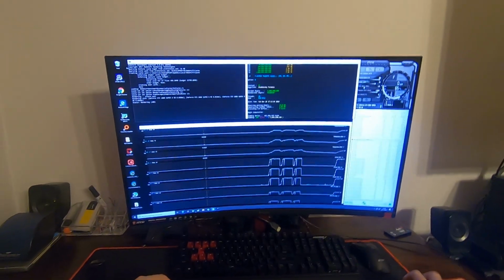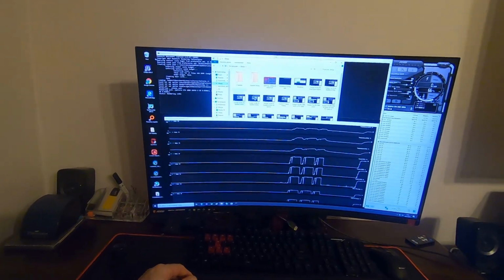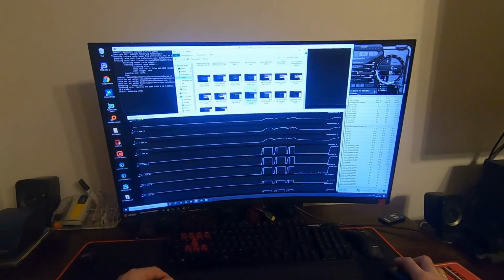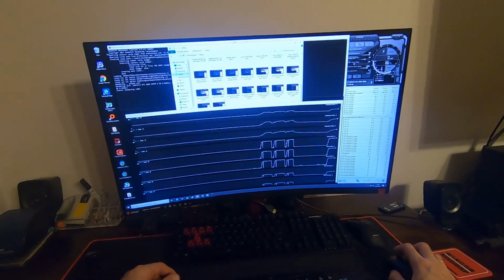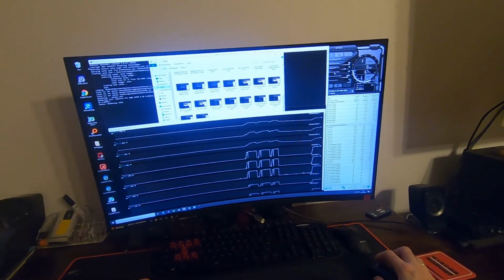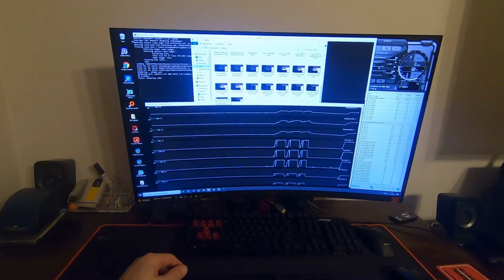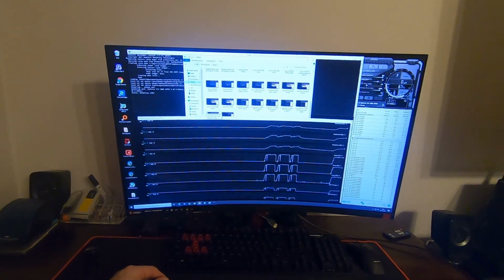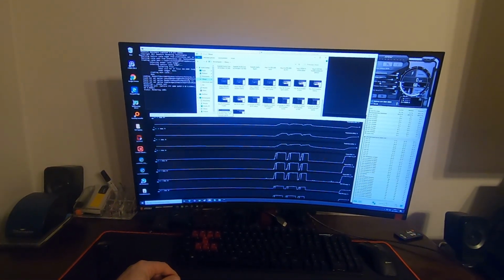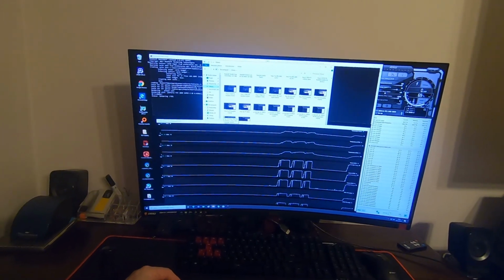Any other thing that I have tested, I've tested thoroughly with Corona, V-Ray, Octane, V-Ray Next, and Redshift, as I said. All the tests have been made with six different profiles, from 4.4 gigahertz to 4.8 gigahertz, and the best possible outcomes, of course not for CPU but for GPUs, are at 4.7 gigahertz for this particular CPU and this 3200 megahertz RAM.